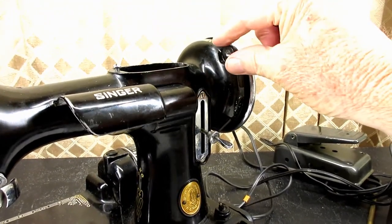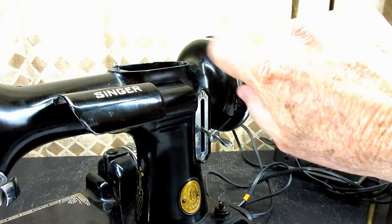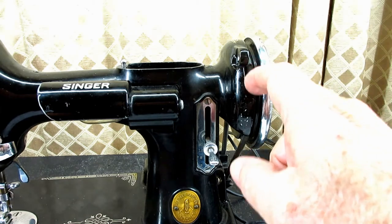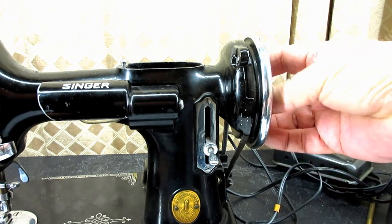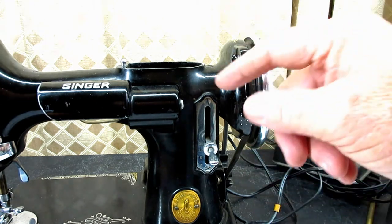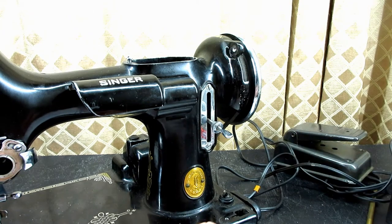This part of the casting is called the belt guard - it guards the motor belt. It has a little ear that sticks up where we mount the bobbin winder frame. There's a little cut-out area in there and that's where the friction ring contacts the motor belt. So when you put the machine in bobbin winding mode, run the motor, the hand wheel turns because the belt is rotating, and that will rotate the friction ring and spindle to wind the bobbin.